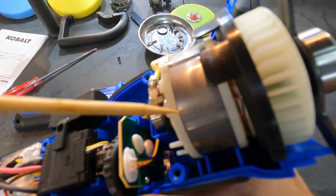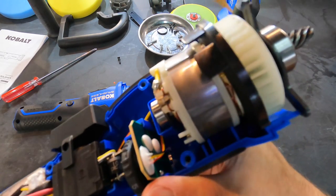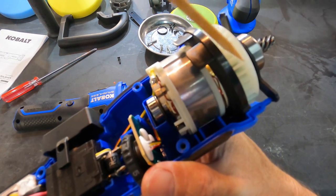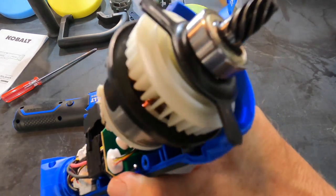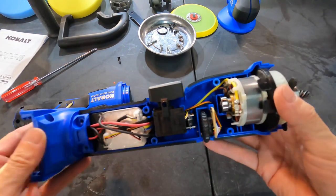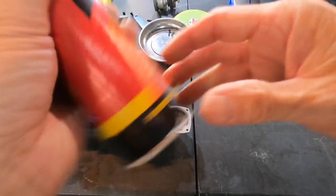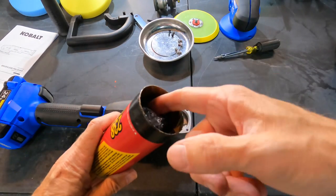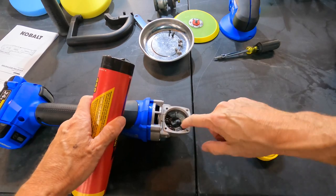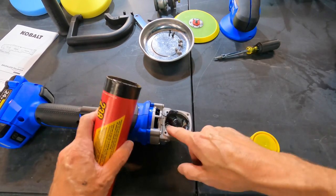We do have clean laminations, a nice compact motor here. Again, the field windings on this side aren't coated. The fan, I would like to see directional. You get more airspeed and movement for cooling. I do like to see, however, the nice sealed bearings. I believe they're Japanese. The way it's put together, guys, it's a mixed bag of low quality and high quality items, but the build itself is not bad.